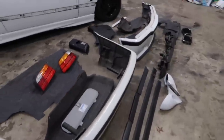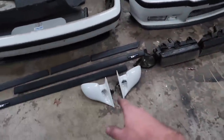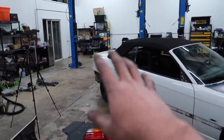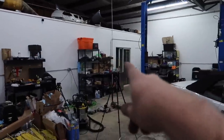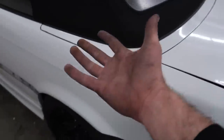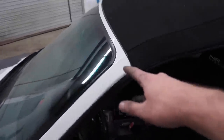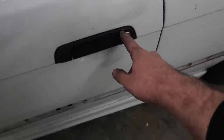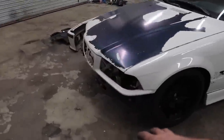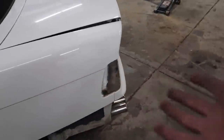Look how much we got off in a matter of like four hours — pretty much all the trim pieces, the rear bumper, the front bumper, the side mirrors, the headlights, all the engine bay stuff, all the wheel guard stuff, tail lights, and a few other miscellaneous things — little pieces from the trunk, pieces from the side skirts, all that stuff's on the counter. The E36 is pretty much ready for wrap. All I want to do now is get this top down so we can pull it upwards and wrap underneath it, and also get a little better clearance here. I also want to remove the door handle in the next video. Everything on this car was so easy to take apart — front bumper four screws, headlights four screws, side mirrors three screws, rear bumper about eight screws.